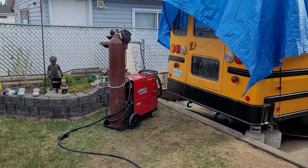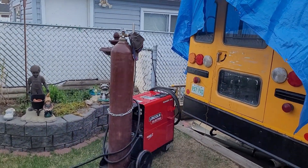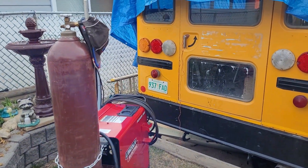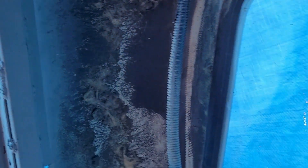I was not expecting this — Dad is ready to go before I even got here. In order to fix this back panel and make it match up with everything else when I put it back on, we're going to weld a piece of one inch flat bar along the side of this angle iron so that I can drill and rivet this piece in and hold it nice and snug. We were thinking of welding it but that's just not going to work. I have to do it on both sides because all that had to be cut in order to do the raise.